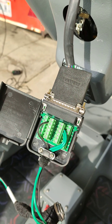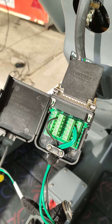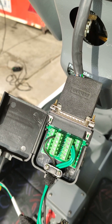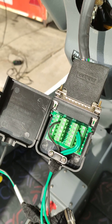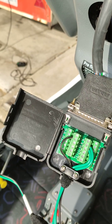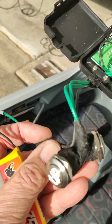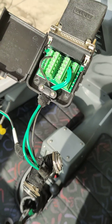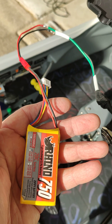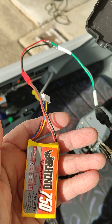Here's my setup to force the prop pylon in and out from the DB25 that goes to the ILEC normally. The DB25 is connected to another DB25 with screw connectors. Poles 9 and 10 are connected to these two push-button switches — up and down — and contact number 15, which is ground, connected to the minus pole on the auxiliary battery that drives the relays.